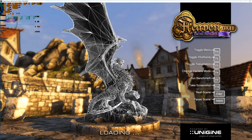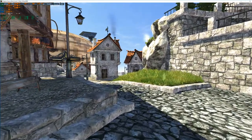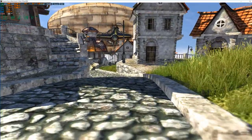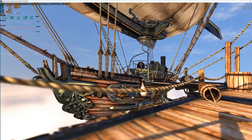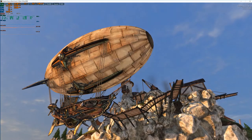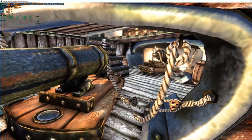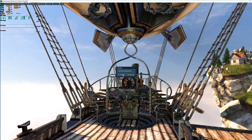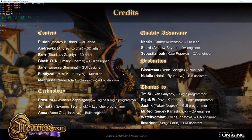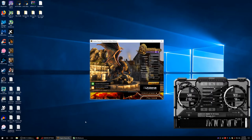But at 1450 MHz we can only go down as low as 1100 mV, and I don't even know if 1100 is actually stable — I'd have to run the stress test for an hour. That's the major downside. Maybe saving another 10-15 watts. But you can see once we undervolted we lost about 5 frames. So at 1340 MHz with a thousand mV undervolt we got all the way down to 105 watts, which I'd still rather have than 1450 MHz for saving power.